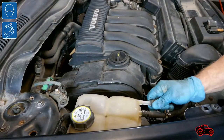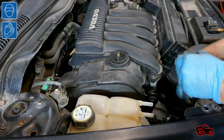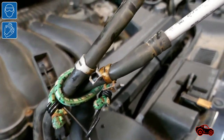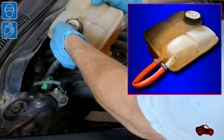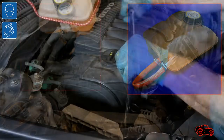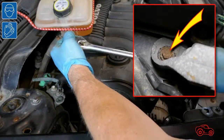To gain access to the upper right side of the engine, I disconnected the two small coolant hoses from the coolant reservoir and secured them over the radiator. I moved the reservoir aside and later sealed it with a short hose. Then the upper section of the engine mount assembly was accessible.